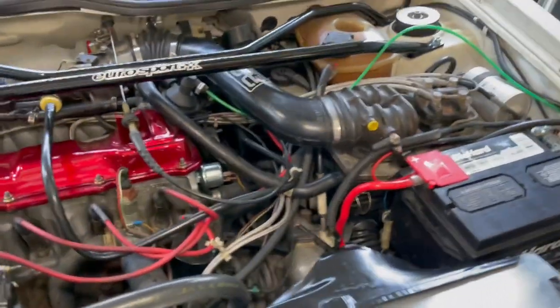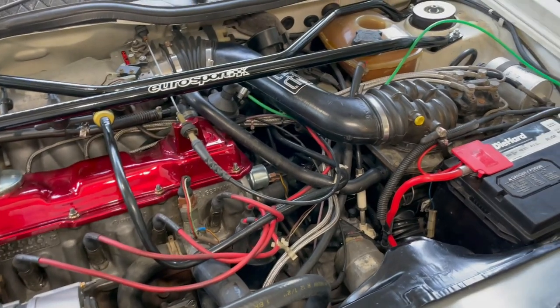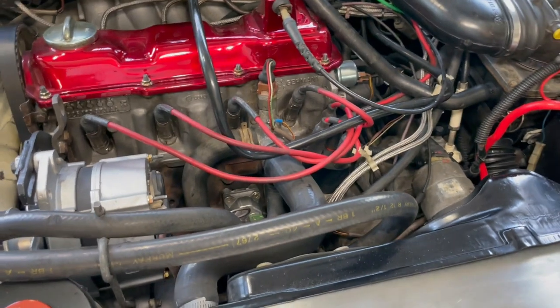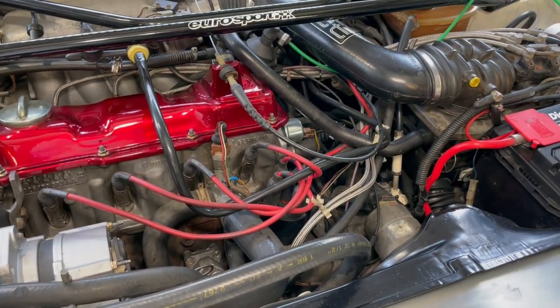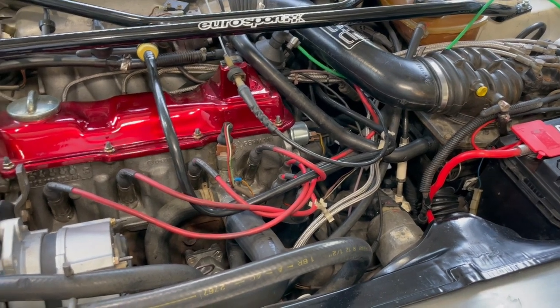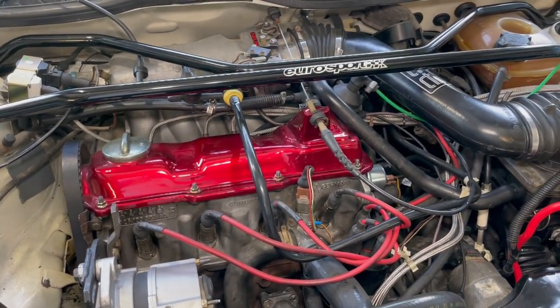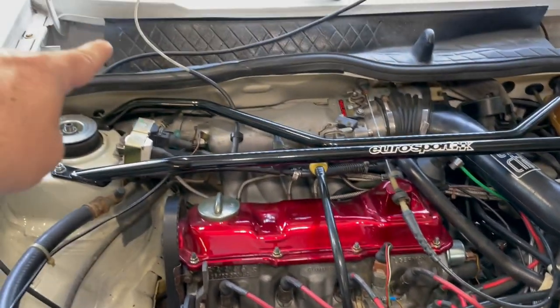So I've been systematically going through the fuel injection system — checked the fuel pressure, checked and cleaned the warm-up regulator, things like that, cleaned the fuel injectors and the cold start injector. But while I was going through everything again, I was running a test where I went in the back and reached to unplug the O2 sensor.